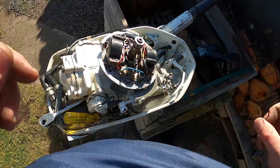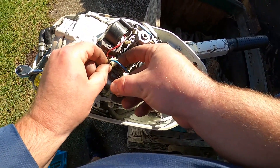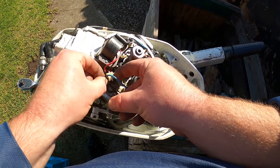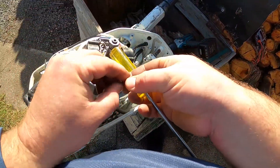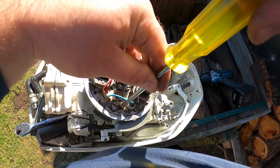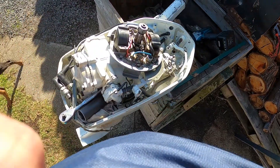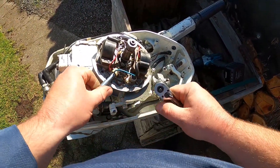I'm going to push that back in, get my little nut. I'll do that condenser up in a second. Just put the nut on here — it's very fiddly. Let's get this nut back on. Do that up, put our condenser in there. Don't have to do it up too tight so you strip it. And that's how you test these condensers, or capacitors, or whatever people call them.